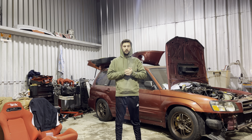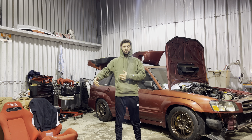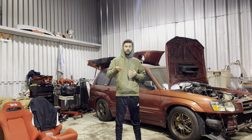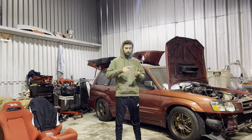Your 255 that you blew up in your Legacy, Outback, or WRX — that's anywhere from like 05 Legacy GT all the way up to 09 Legacy GT, and 08 WRX all the way up to 14 WRX. Same thing goes for the Outback XTs that shared all the same electrical components as the Legacy GT. It's all interchangeable. The EJ20X and Y are both interchangeable with those chassis.